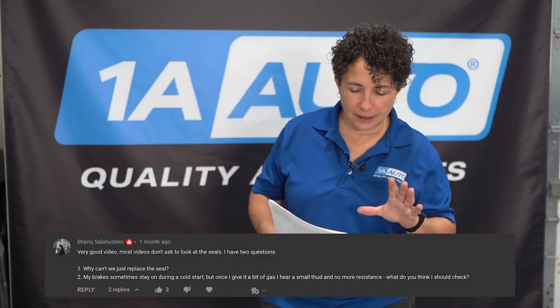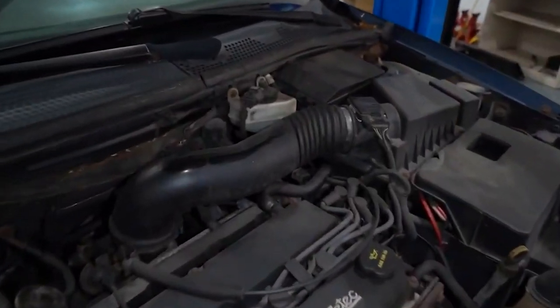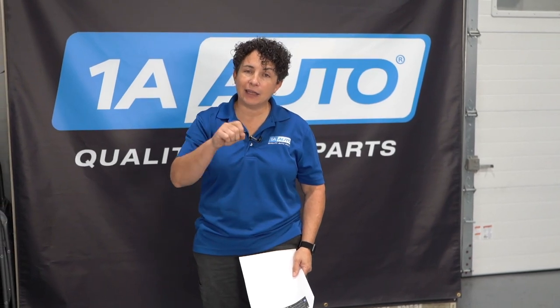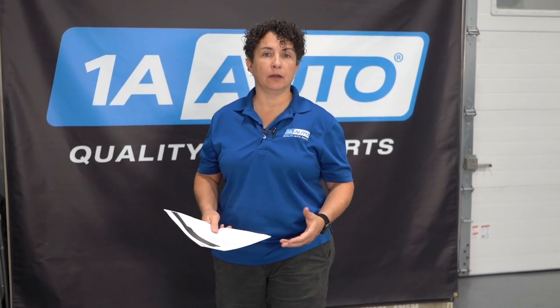This is a two-part question about the video I did on the brake light coming on only when I turn the car — it ended up being the master was low. I got into depth talking about seepage, checking for leaks, where to look, and if the caliper has a slow leak, what to do. I talked about a caliper dust seal and the internal seal. If you can get a caliper kit, you can rebuild it and put it all back together. But you've got to check for any scoring on that piston and replace it if it's got a hairline crack. Sometimes when you weigh your time rebuilding it versus buying a remanufactured caliper that already has a warranty on it, it kind of weighs out the difference — so do that kind of homework.